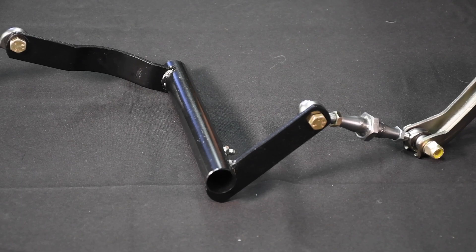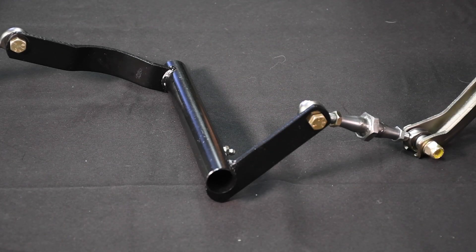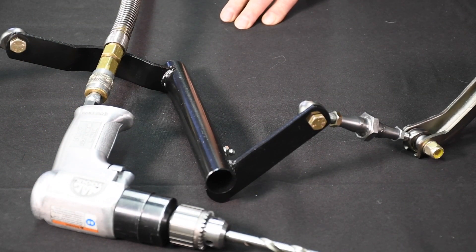For example, the pin holes — that's where this bolt passes through — in a typical GM clutch linkage measure 5/16 inch in diameter. Given some time, that hole diameter becomes oval. Building a clutch linkage with 5/16 inch rod ends won't help much because the holes the bolts pass through in the pedal as well as the z-bar will be sloppy. You're pretty much forced to move up a size in rod ends. That means you should use a 3/8 inch diameter rod end, not a 5/16 inch job. Drilling out the respective holes in the z-bar or clutch pedal to 3/8 inch will take out the oval. Besides, a 3/8 inch rod end fits the same diameter tubing you'd use for a 5/16 inch rod end — just the tubing adapters are different.